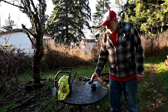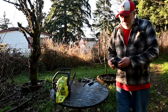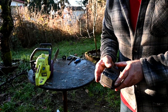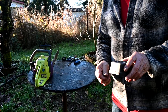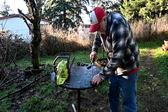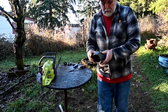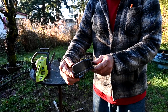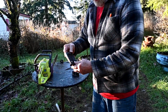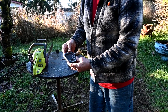We got the muffler off and the different pieces here. If you have one of these saws — the Craftsman version or any of them — these two little areas right here are the only places the exhaust comes out and it's really restrictive. I had a bunch of carbon in them when I first looked at it but it's a simple fix to modify it. Take a screwdriver, stick it down in there, and open them up. That substantially increases the area where the exhaust can come out. Then put some holes in the cover here too.